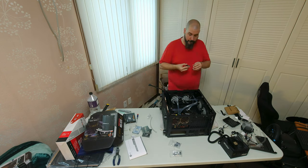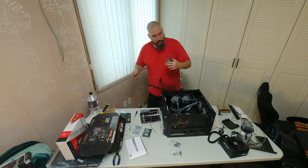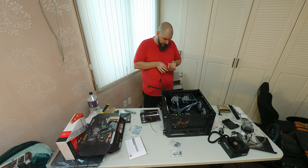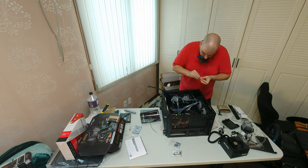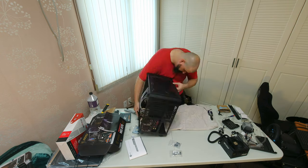Here I'm getting ready to install my M.2 SSDs. I'm installing the GEN3 boot disk in slot 3, which should be the one attached to the chipset, so the GEN3 disk shouldn't have a problem with bandwidth. The two GEN4 disks will use the two sockets directly attached to the CPU.